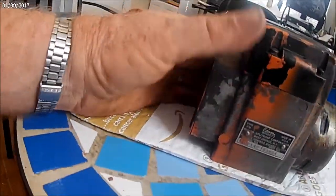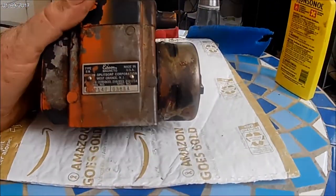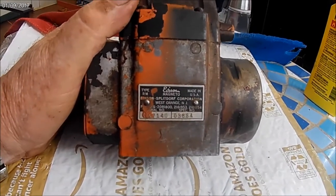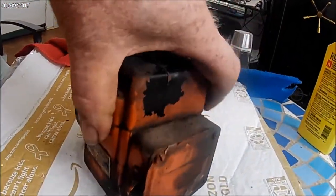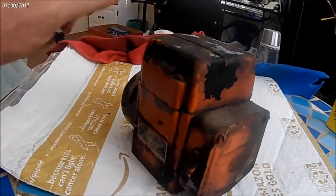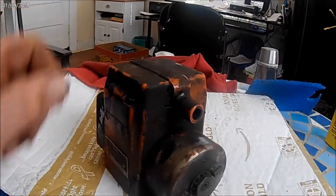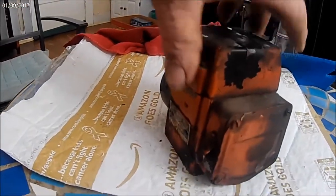This is the magneto off that — oh, that's the AEH model, Wisconsin out there. And that's an Edison magneto. I've never actually seen one of them. It doesn't seem to have any spark, so obviously we're going to have a look at this. I'm assuming the points are back under here, with the coils up on top, because that's where the spark plug cable goes. We'll take a look and see what's going on — I think it's lined out here.